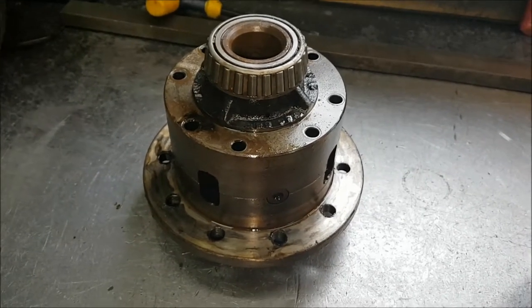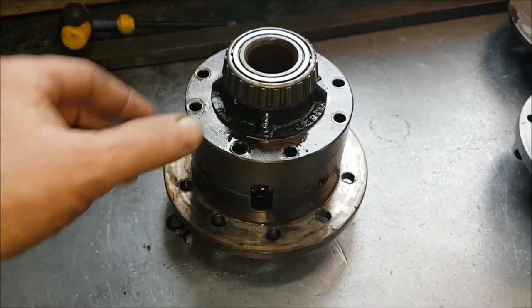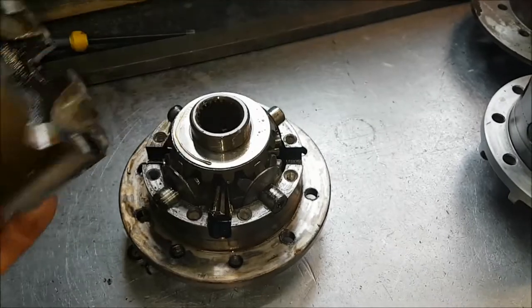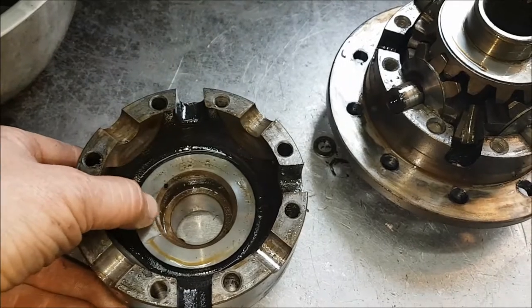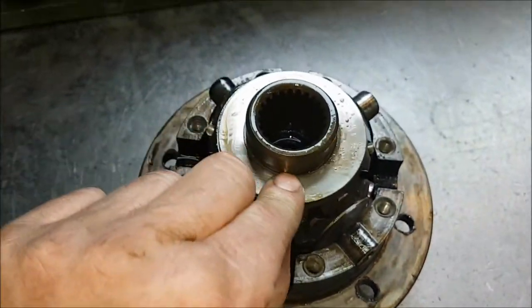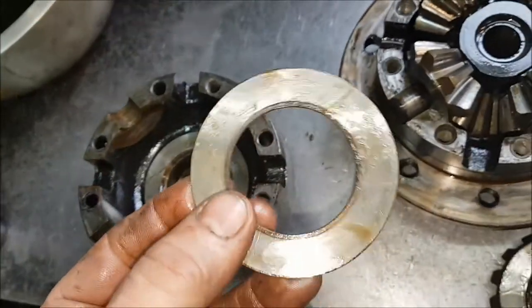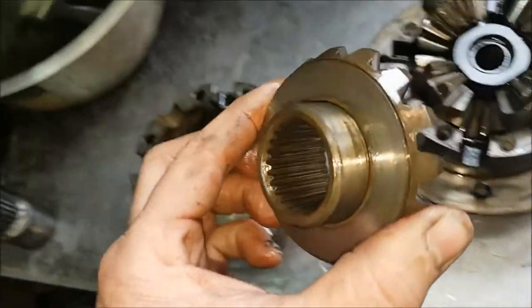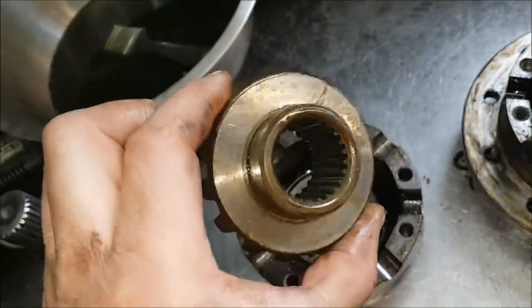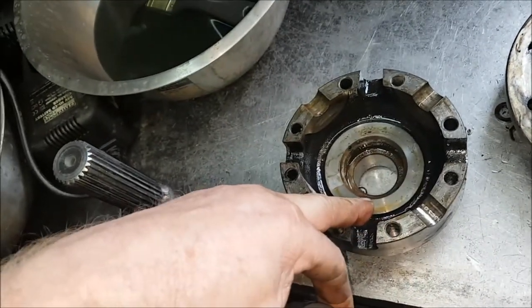Okay, so if we turn our attention now to the standard V890 or military four pin, this is held together with 8 bolts, and when you take it apart, in here you've got sometimes a shim and sometimes not. Now on this one there is a shim. So between the face in here and the back of this gear set, on some of them, particularly the military ones, they have these shims that fit on the back of the gear. We've got these in stock brand new, and they're not very expensive. Now these are designed to take the face thrust from this gear going against this face here.